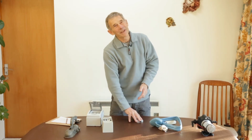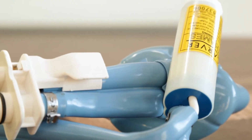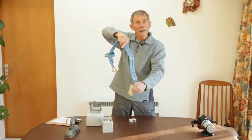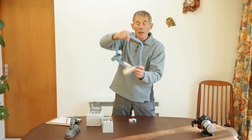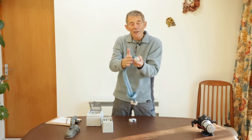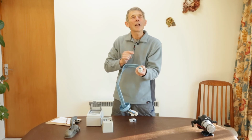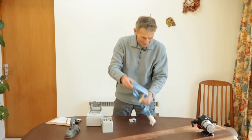Electricity, it sounds silly, but let's turn to water. Most modern caravans that are in the less expensive range use a submersible pump, and many of you may have seen these already. They're lowered into the water container. You may shake them around to dismiss any kind of catching bubbles, any airlocks. And there's a paddle wheel in the bottom, and this spins round and it pushes the water along the pipe. That's why some people refer to them as pusher pumps, but they're really better called submersibles.